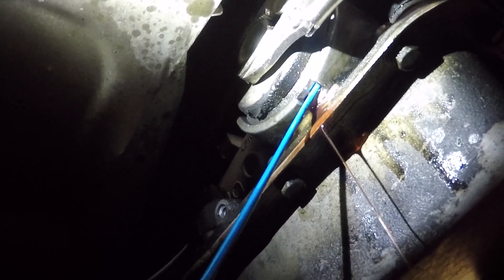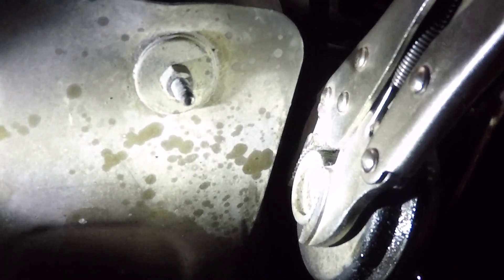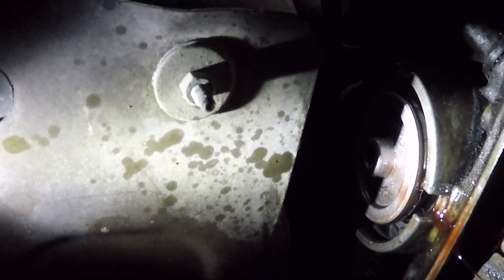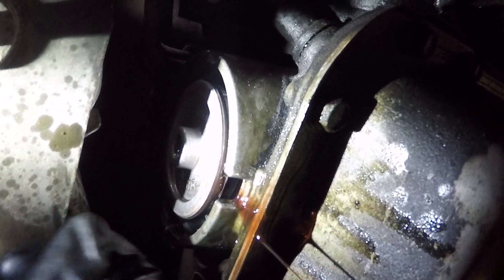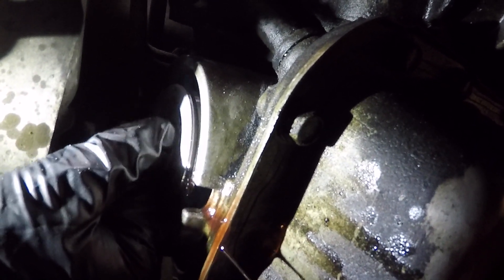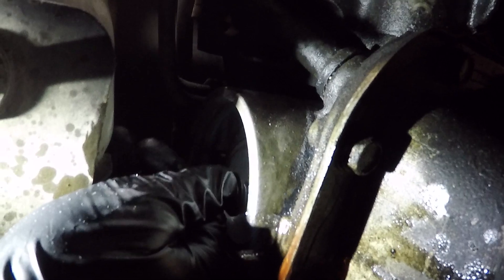And the gasket that you see now exposed itself. So I took this pick right here, grabbed the gasket and then broke the gasket. So what I am going to do is I am going to continue just pulling on the gasket, remove that all the way. I should be able to — yep, there it is. Pop that cover right off. Now I am really glad that I am going to change this fluid here because it is not the best looking. So now that I got that off, let's see if I can get this whole thing off.